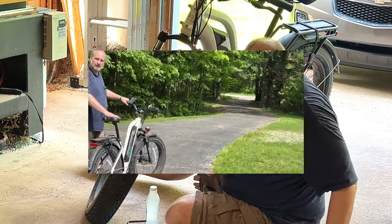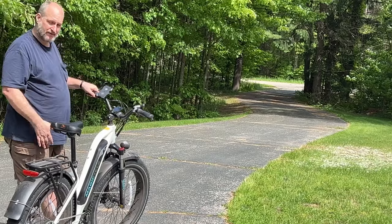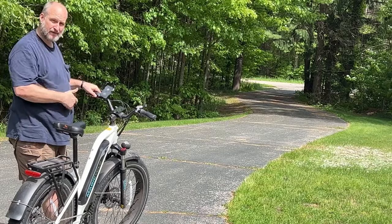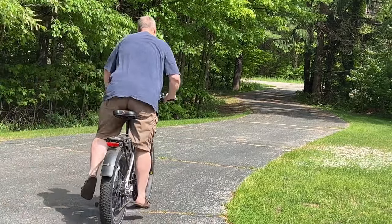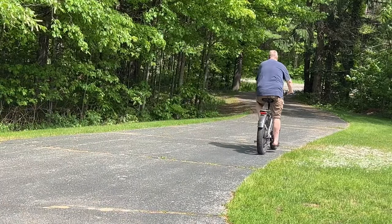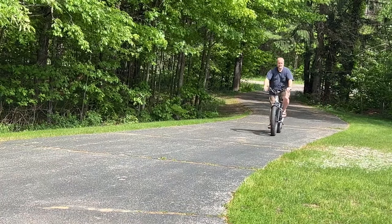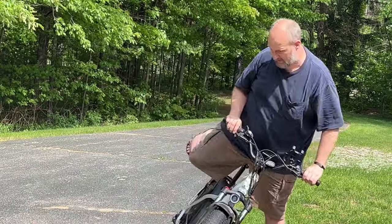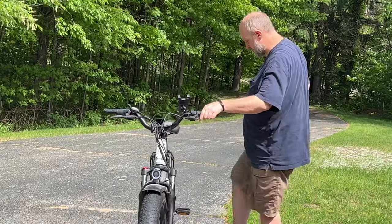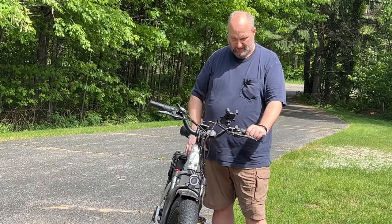Let's take it for a ride. Now that I've put the Squeak Out on the rotor, wore it in, cleaned everything off, and readjusted the brakes, I'm going to take it for another ride and see where we're at. And there's no noise — no noise at all — and I got full braking. So I'd say that using that product was a success. It may take a little bit more time to wear in properly, but I think we're in good shape for now.